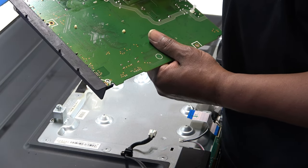Okay, plug everything in. LED plug. Wi-Fi module. Toggle button. My left and right side of my panel. A little clip right here on the connector. Leave it up. Make sure when you go to push it back in, it's in up position. Okay, make sure that both of these tabs are kind of like inside the connector. Okay, make sure it's even. That's why there's a line there. See this line? Okay, so make sure that, there we go, it's all the way in.